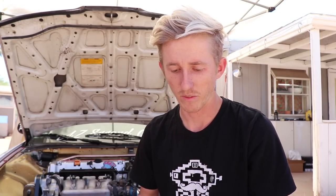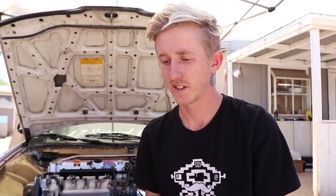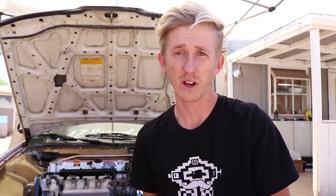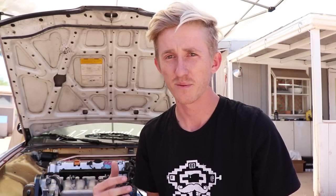Everybody always asks what does it feel like and is it worth it. I want to be as unbiased as I can because I like how it feels, but I also want to support Hush Performance since Robert is a friend of mine. But at the same time I don't fully like it because of how I drive. My driving style is more aggressive — I like to do a lot of backroad racing like canyons, and a big part of that is braking. My braking style involves a lot of left-foot braking and heel-toe downshifting, and although I can still do that with the brake booster delete, it just makes it harder because the pedal gets more firm.